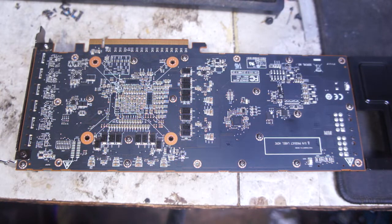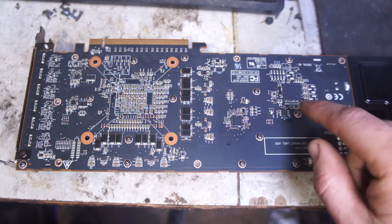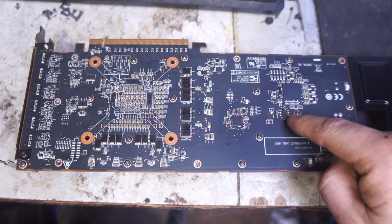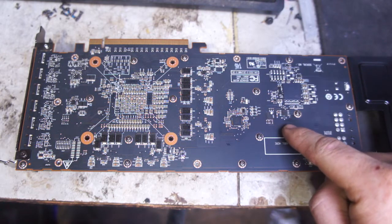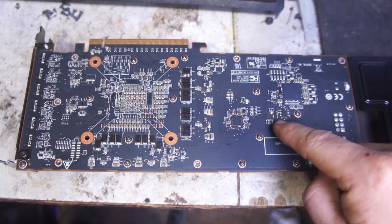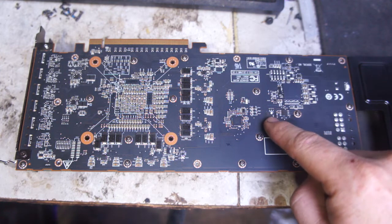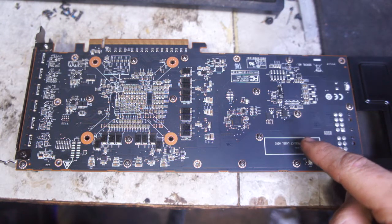Here are your two VBIOS chips — firmware chips. When the card initially boots, it reads the firmware from this one. After boot, it switches over, so anything that tries to read the firmware reads from this one. So if you flash just this one, after Windows loads it tries to read this and compares that to what your motherboard told it was in the slot — basically comparing this chip with this chip.